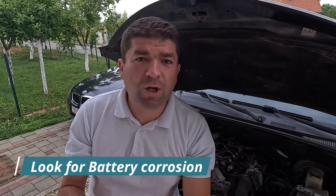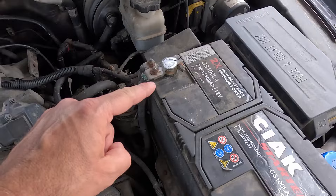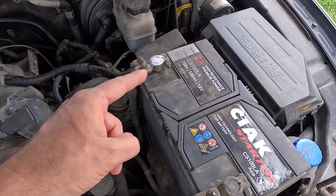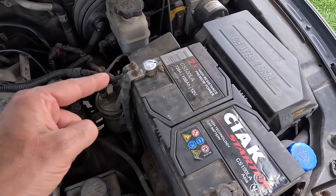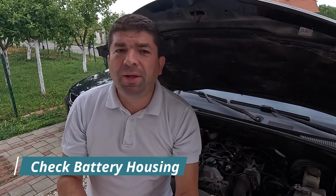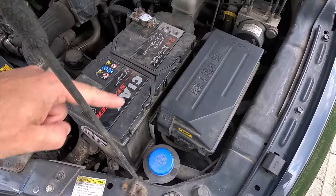The first thing that can be seen straight away is the battery terminals, which shouldn't have any traces of corrosion on them. This white-green powder-like substance will form as a result of acid evaporation and, if substantial enough, might prevent current flow from the battery to the rest of the car. Luckily, as I'll show later in this video, this problem can be easily solved by simply cleaning off the corrosion buildups. While working around the battery, you might as well check its overall condition, as this will reveal any cracks or bulges on the casing.